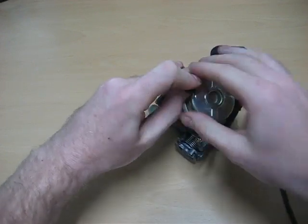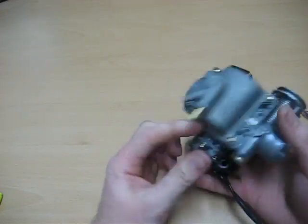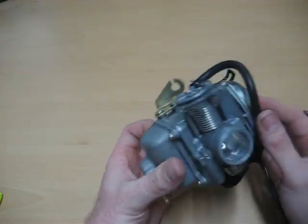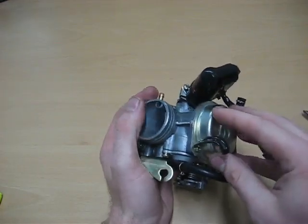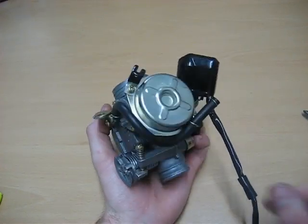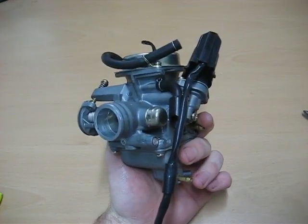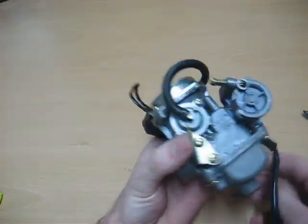And that's pretty much what it takes to clean a carburetor. Now if there are any gummy deposits in there, you are going to want to check every single pathway. Carb cleaner is going to work great down at the bottom. To repeat again, anytime you're working near the diaphragm or any kind of rubber piece, you're going to want to clean it with gasoline, as carb cleaner is harmful to rubber and plastics. And that's pretty much it.